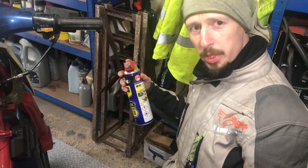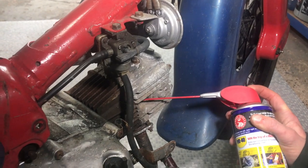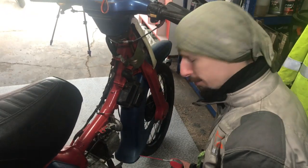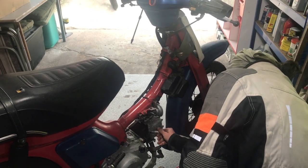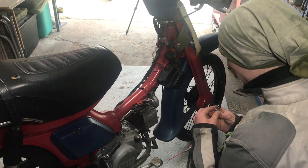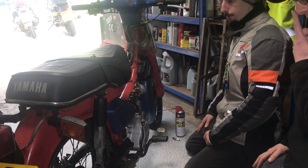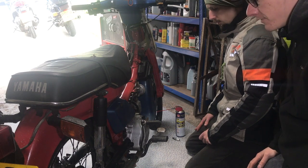Getting the penetrating lubricant spray ready — give a little squirt inside, down the spark plug hole into the barrel. It's a little safety precaution for working over any old engine, just so it's not ploughing away dry. Obviously there's not going to be any oil in there; this bike's not been run for many many years so it will be very dry down there. We're going to try and move the piston by hand, just lubricating it a little bit to try and ease that process. So the spark plug is still out and we've put a little bit of WD-40 down the barrel. We're going to use the kickstarter to see if we can move that piston up and down and see if it's actually free to move or if it's completely seized.